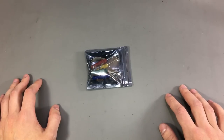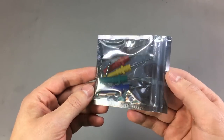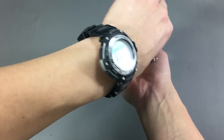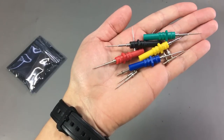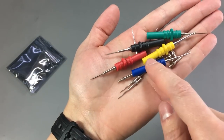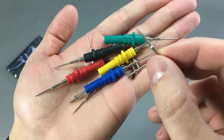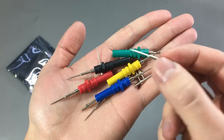For each of the items shown in this video, you will find links in the description below. My first item is this set of 5 automotive test pins. Let's get them out of the anti-static bags — I'm not sure why they used an anti-static bag because these are not sensitive to static discharge. The set has part number P8002, and inside you get 5 test pins in 5 different colors, plus 10 spare tips because these sharp tips are removable with a thread.